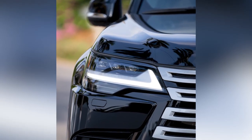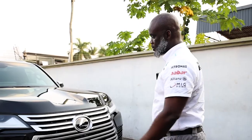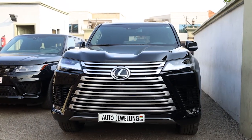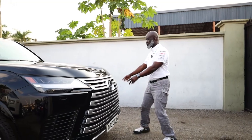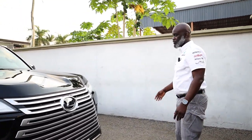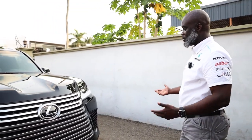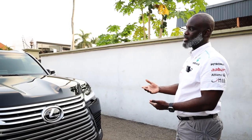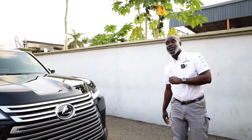This is a three-piece bumper system — something very new to Lexus. The grille is a separate piece, the front corner bumper is a separate piece, the lower brace is a separate piece, and this corner is a separate piece. This was quite new to us, but we figured out how to strip the whole car down and paint them individually — painting the front and back as well — so that we can hide every single trace of the original white the car came with.